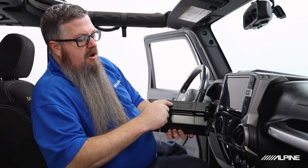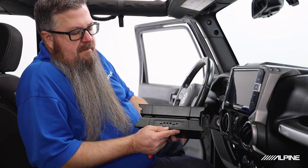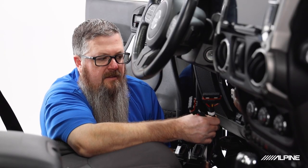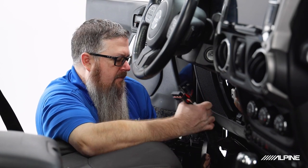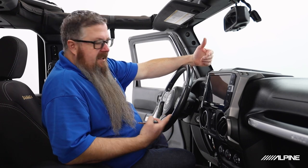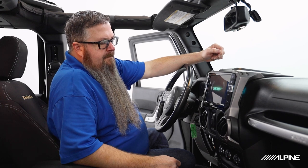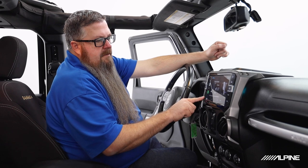Now, before we mount our amplifiers, we're going to remove the cover plates for the controls and make sure the settings match what's outlined in the manual for your specific radio. With the cover panels off and amplifier settings matched to the installation manual, we can go ahead and plug them in, reconnect our negative terminal, and make sure we're happy with our sound settings. Note that the plugs are labeled KTA30FWRA and KTA30MWRA — make sure you plug the right plug into the right amplifier. Power up the radio, make sure everything sounds good — keeping in mind the driver's side speaker hasn't been mounted yet.